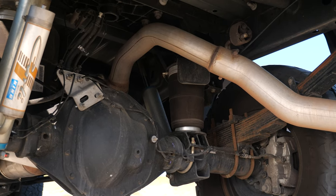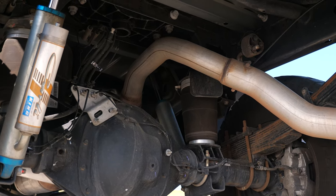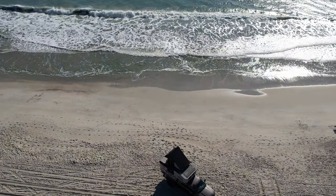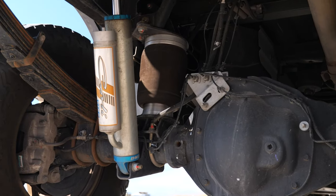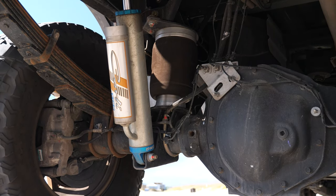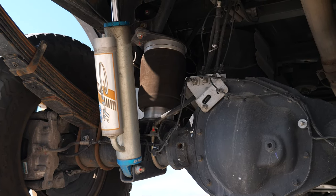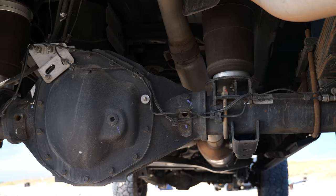With this truck changing weight drastically, the one-ton capacity of the spring is usually sufficient. This truck will go from completely empty in the bed to a camper like the Scout we're running right now, which is roughly 2,400 pounds wet weight with all of our water and camping gear. I've been camping out of this truck for about two weeks now, and the truck handles it like a dream. When I put the heavy trailer on, I can bump a little bit of air in the airbags, increasing the spring rate a little bit, keeping the truck sitting level and it handles really well down the highway.